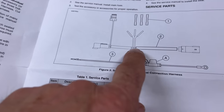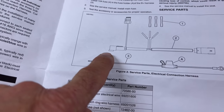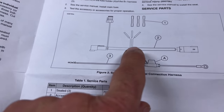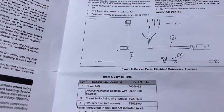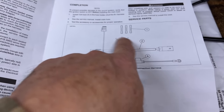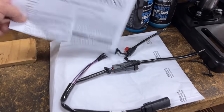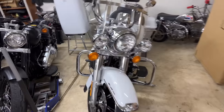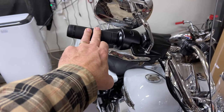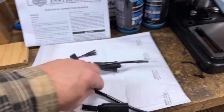The 'A' coupler - remember yesterday I thought something was missing? There is. You've got the coupler that ties into the bike - this is an accessory coupler, these are accessory wires so you can plug in whatever. Then there's another wire that's one of those molex connectors, kind of the same setup but a smaller plug-in. I can't find it - I searched through my boxes and another place where I have Harley stuff and I don't have any of the wires. The heated grip kits come with three different wires, one of them's a jumper, and it links all that to this kit. The reason you put this accessory kit in is it isolates whatever you plug into this connection kit through this 10 amp fuse.